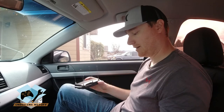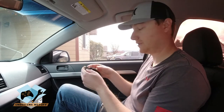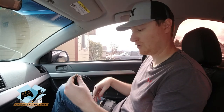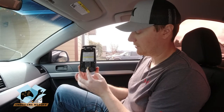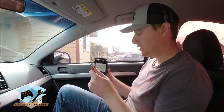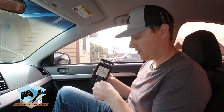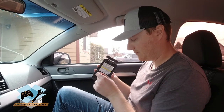The booster is all ready to go. At this point I'm going to take out the shorter of the two cables included with the kit, because this is a smaller car so we don't actually need the long cable. You always want to use the shortest cable possible. I'm going to screw this right onto the bottom SMA connector and take my small wrench to very lightly snug down this connector. If you wrench on this hard at all you're going to end up breaking it, so you just want to do it very lightly — just a little bit more than what you could do with your fingers.